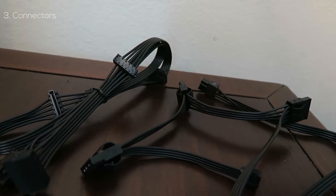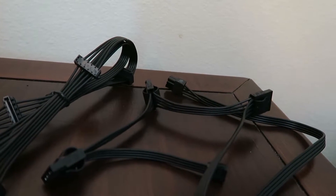The next thing we're going to be talking about is connectors. One end plugs into the wall and the other end plugs into all your components. That's going to be various different connectors — graphics cards will use 6+2 pin connectors, DVD drives and storage will use SATA cables. You need to make sure that whatever components you have, the PSU has the matching connectors. I'll have a link in the description with a picture of all the cables that could be on a power supply.